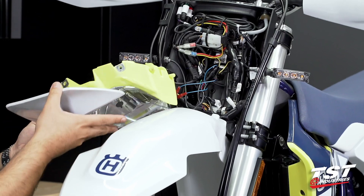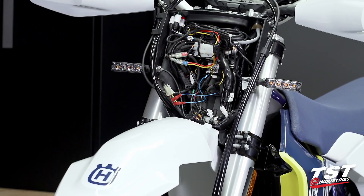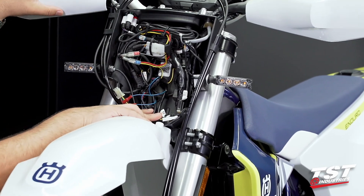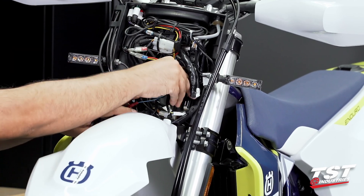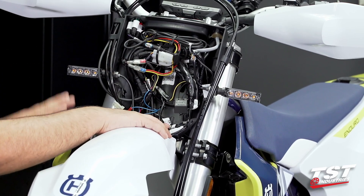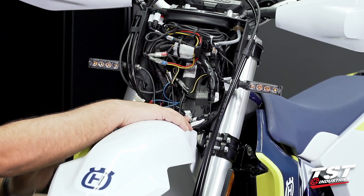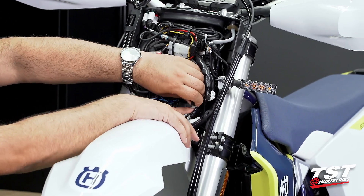As you can see, we now have full access. In order to not stress any of the connections, I'm going to disconnect the headlight and place that to the side. You can see here, located on the right side if you're looking at the bike — or the left side if you're standing behind it — we have our stock relay. It is on the bottom right behind the headlight, sitting on a post, and it is the only relay located there. Note that this particular rider has installed an aftermarket dash, which is why we have more wiring than you may find on your model — but this is the factory location of the relay regardless.